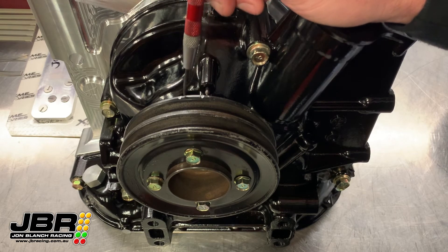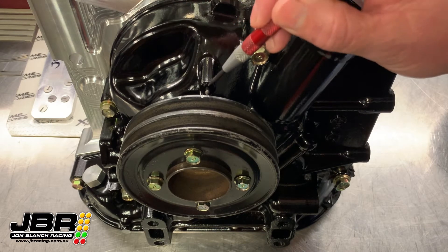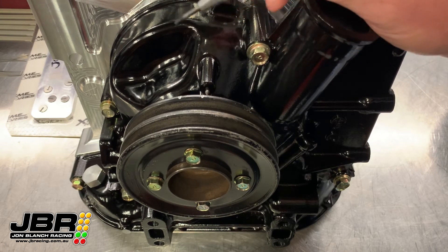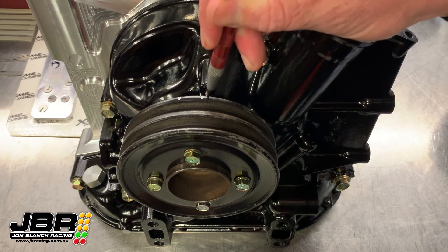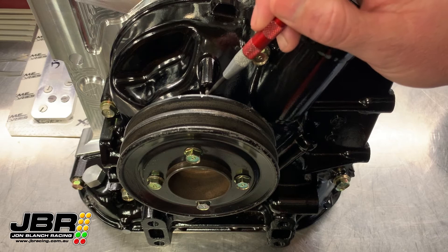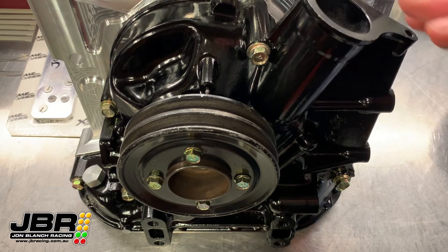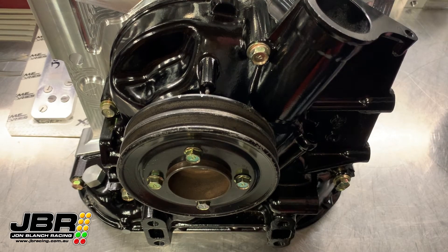You've got your two factory marks here — this factory mark is 5 degrees after top dead center, this one is 20 degrees after top dead center, meaning we've got a 15 degree gap between the two. Looking where the pointer is, TDC is right about here. To mark it I would use my center punch like so, put that mark on there, then come back later and put the liquid paper or nail polish on it so it's easy to see with the timing light. It's as simple as that.